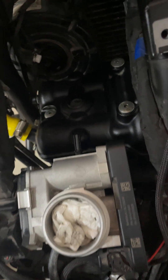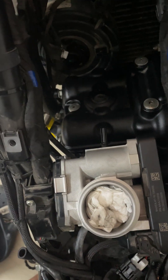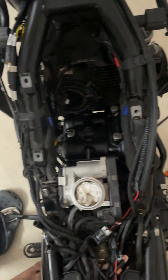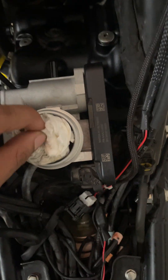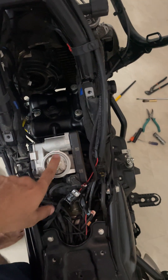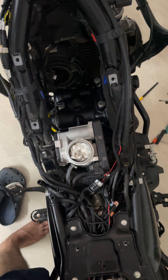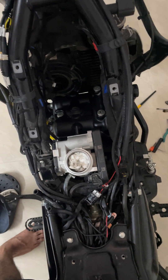Hopefully this should be the end of it. My valve clearance is around spec: 0.15 on both inlets, and 0.25 or 0.26 on both exhausts. Very happy, and the sound has also gone down considerably. Hoping to be back on the road again with this beautiful machine, the Sherpa. This is the condition of the throttle body — that's how it's supposed to be. For all the fellows who don't have that color, this is 10,000 kilometers later, as good as new. If you don't have it, then you're doing some kind of damage — there's some kind of nonsense going on through your air filter.